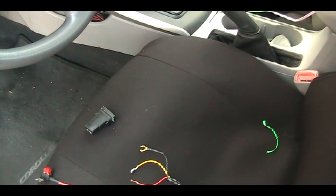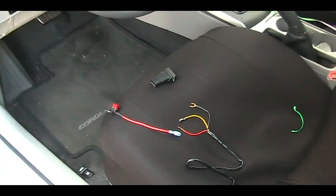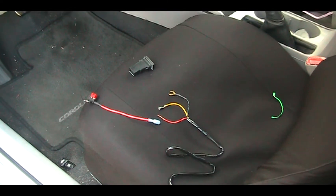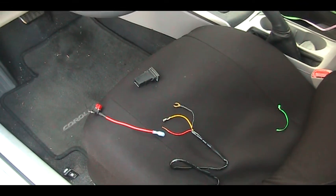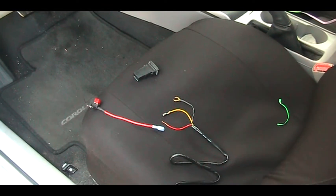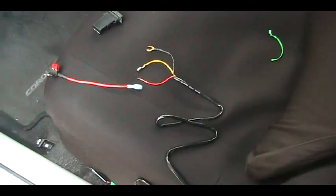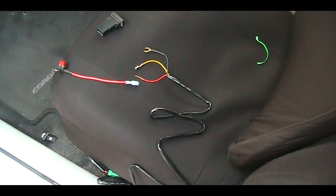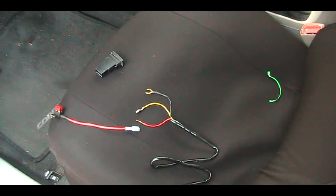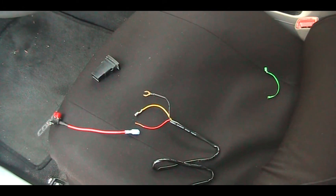If my tail light did not turn on, then the fog light will not be turned on. There are many ways to install this, and this is what I wanted — I don't want the fog light to turn on when the other lights are not on. Some people also tapped a wire to the dimmer area, and some have run a special way to the fuse tap.